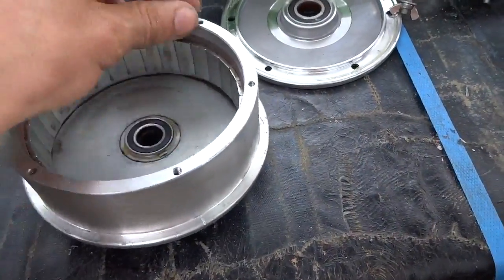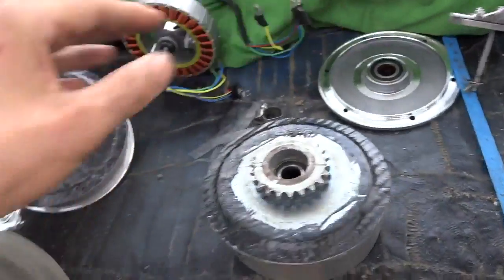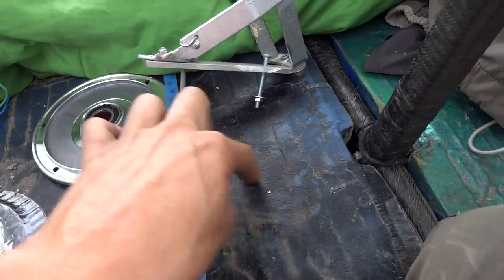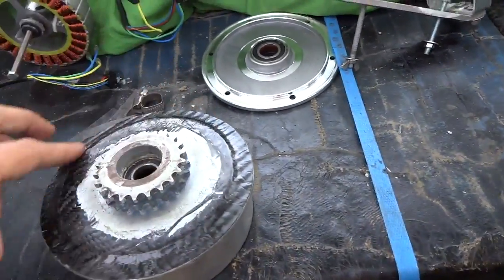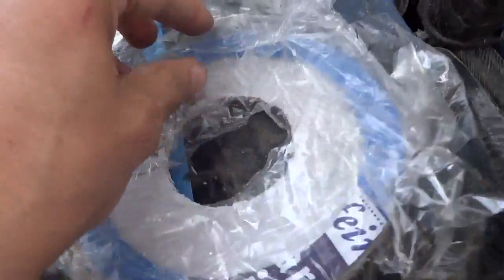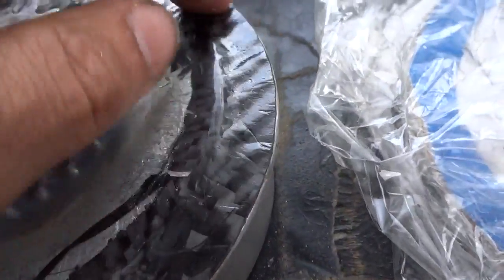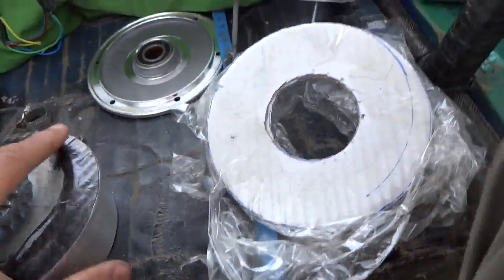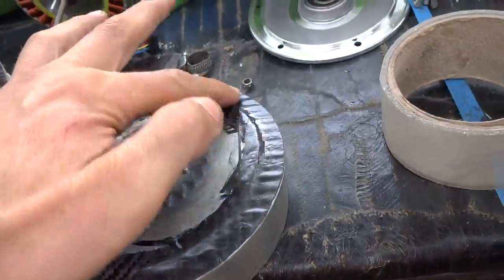Hoverboard motors get warm quickly — the missing iron in the back may be a bad design, but they're cheap and nice motors worth experimenting with. For the repair: put the motor upside down, apply epoxy on the round surface, place the backside on top, then add carbon. Use 12 to 14 centimeter cardboard pieces to press the carbon against the aluminum and inside. Wrap with tape and let it cure upside down for good contact everywhere. I think this repair will last for the rest of my trip.